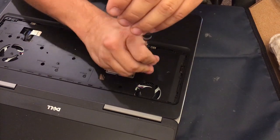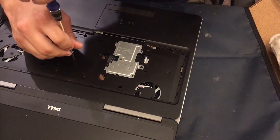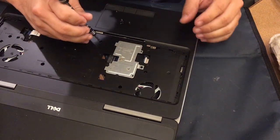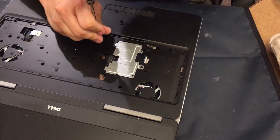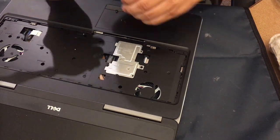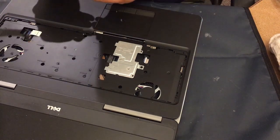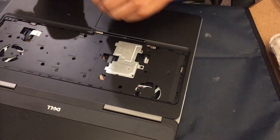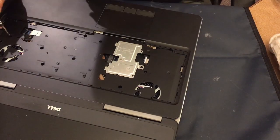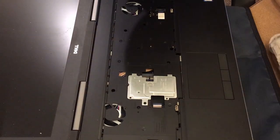This is basically just the reverse of before — put the keyboard back in, make sure the cables are connected, and get the screws in the keyboard. Put the bezel in and make sure that the palm rest screws from the back of the chassis are all screwed back in. Nothing real difficult. Thanks for watching everybody, this is Cougar, another episode from Technician's Corner. I'd like to wish you all a good day — I will see you later. Bye!